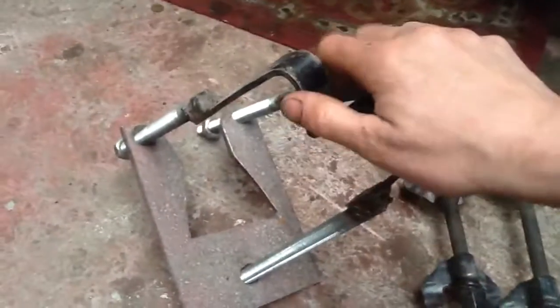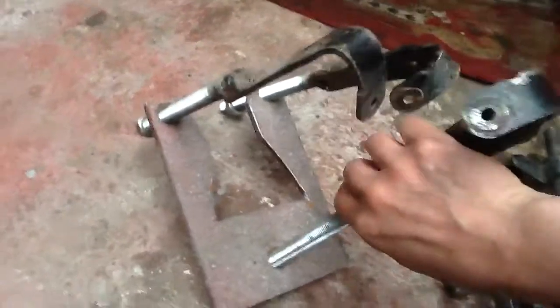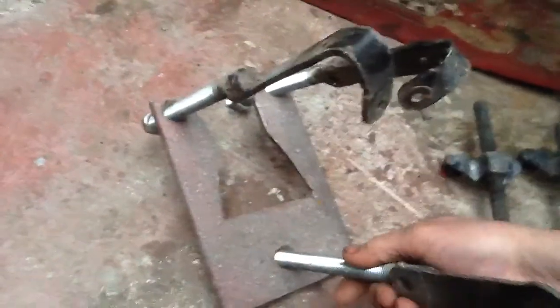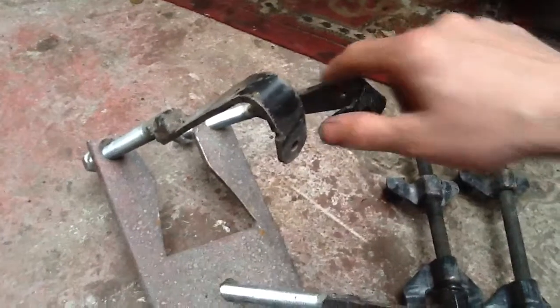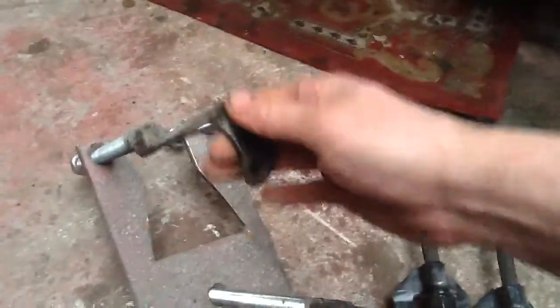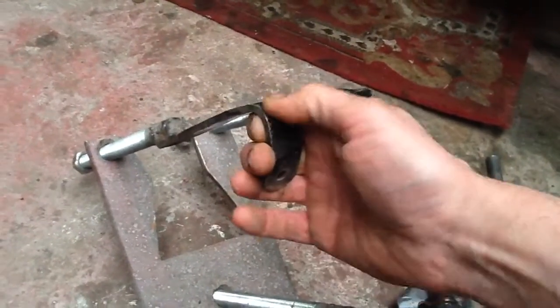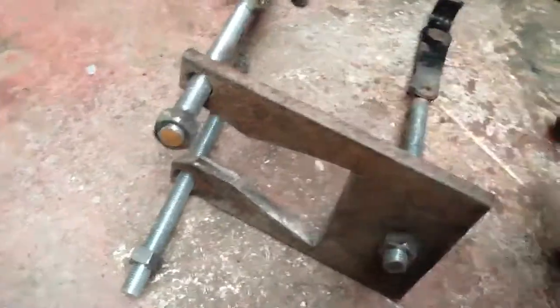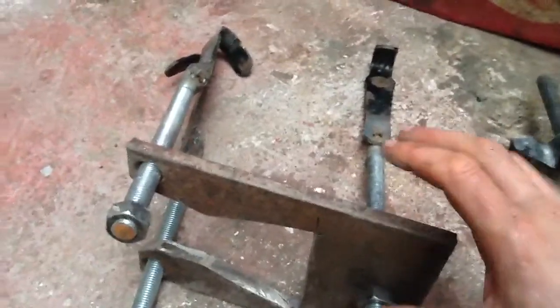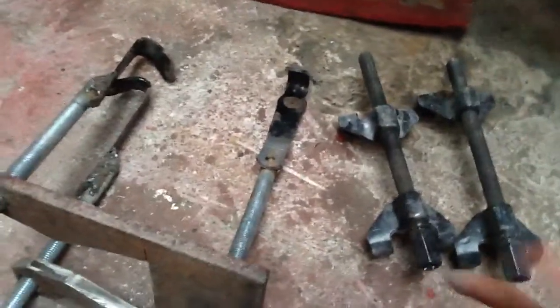top. It's very precarious and I'm not really fond of it, but I didn't have a tool and I didn't know anybody that had a tool, so these are just bits of high tensile 18mm bar, I think. These are parts that are cut off an ordinary car jack, and I knew they'd be high tensile steel. They're probably 3-4mm, but they're strong enough for what I needed them to do. Adjustable bolts, and the plate on it, it's fairly substantial. This tightens, and then when you have it in situ, you release the nuts down and hope that it all stays where you want it to be, and then you can withdraw it that way. So not very pretty, but it got the job done.